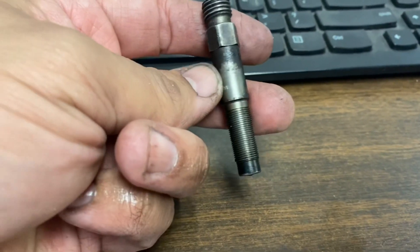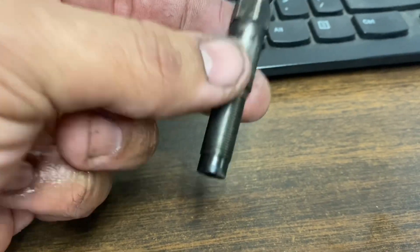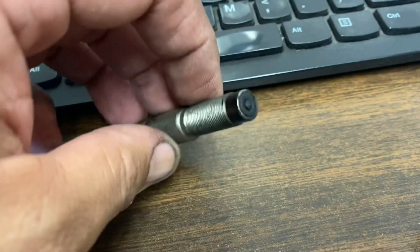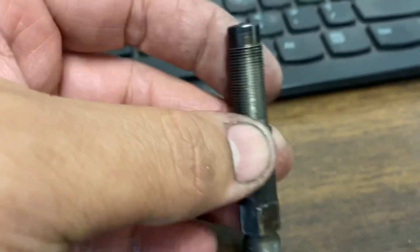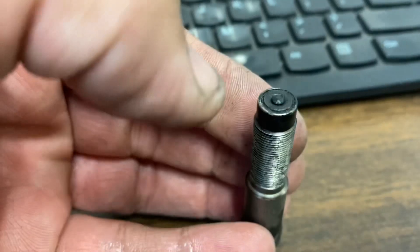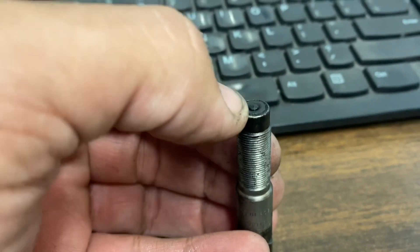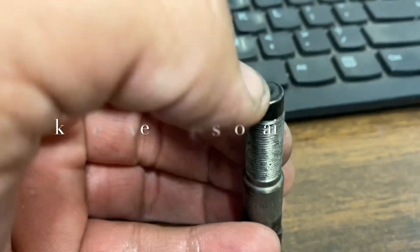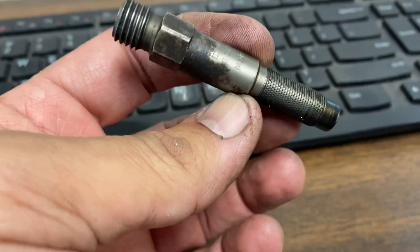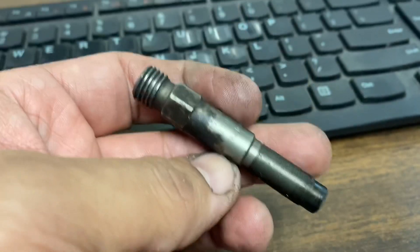This is the diesel doser injector, or 7th injector, really depending on what you want to call it. It's located behind the turbo — whether it's a Series 60, DD13, DD15, or DD16, same thing. What I typically do is remove it, look at the end where it sits, look at the carbon buildup, blow a little shop air into it, and look at this little valve. If it's been injecting diesel, it comes out and lets the diesel spray, then goes back in depending on pressure. On this truck, when I sprayed it with shop air, that little valve or stem was sticking out. So my guess is this was actually the problem, and probably not the sensor — but I replaced the sensor anyway, just to be on the safe side. This little bad boy will either make your temperatures shoot through the roof or not go up at all.